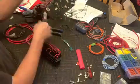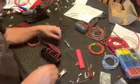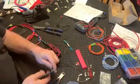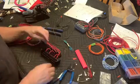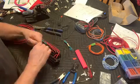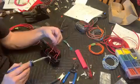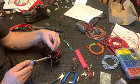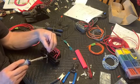And those are going to, like I said, pin 86, and then the coiled up green wire with a white tracer there, that'll be what controls the fuel pump via the ECM, and that's just the GM color for that particular deal. And I happen to have some of that wire, so we'll go ahead and get these all set up and then move on to the fuses.